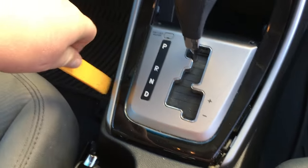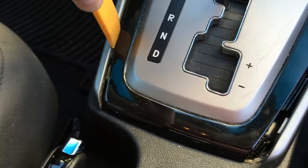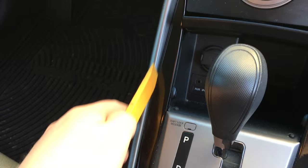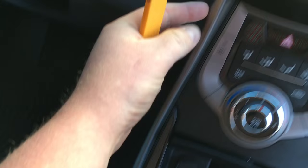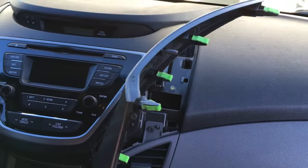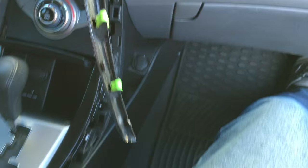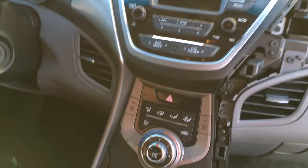Really all you have to do is start at the bottom. I have a plastic panel removal tool so it doesn't damage anything — just kind of work in there, be very gentle. What you're going to do is work that along, separate this piece, and this whole silver piece will come out. As this pops up you can see these clips — just work your way around, applying pressure on those clips all the way down.